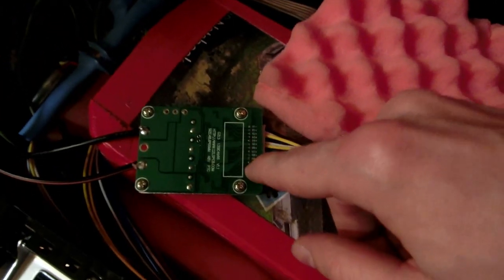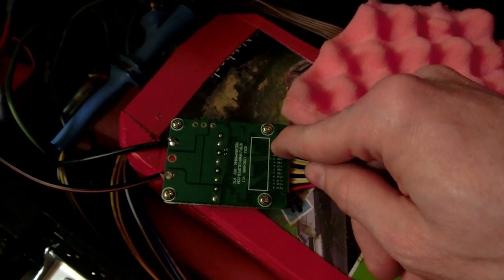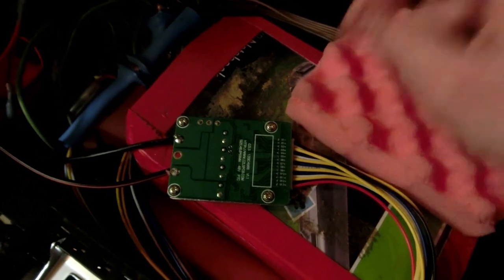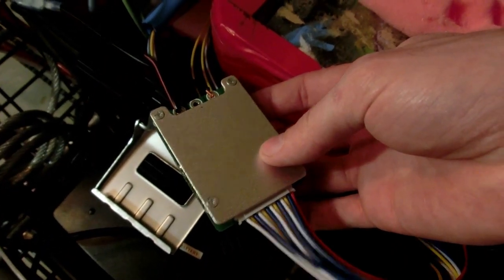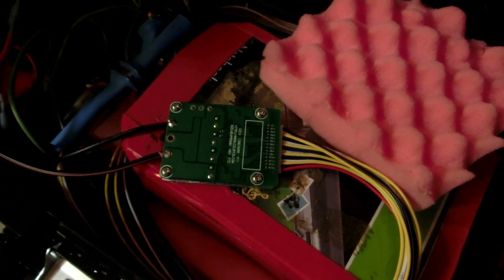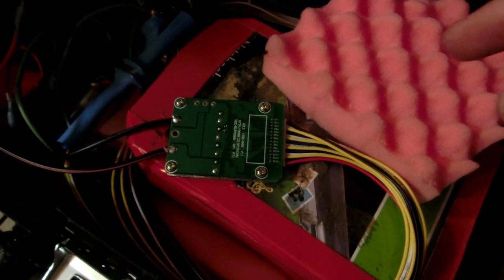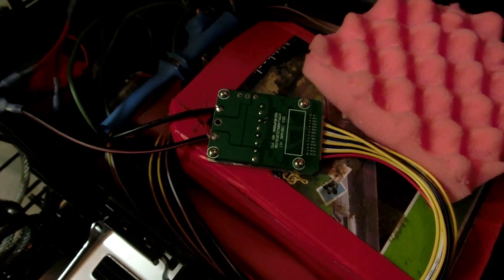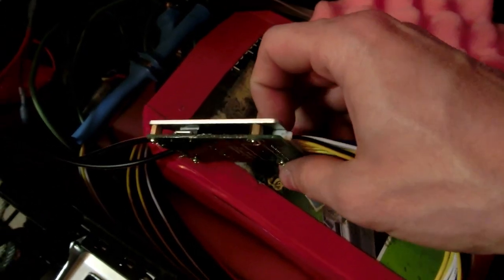The upgrade is actually a little bit noticeable — I have an extra 2 miles per hour on my top speed. It goes up to like 37 or 39 miles an hour now, under no load if I just pick up the front. Now, I've had a lot of issues with this BMS because it doesn't bring all the voltages up to 4.2 or even 4.1. The middle one goes to 4.09, and some of the later ones always go to 3.98. The people I bought it from are sending me another one. It's not balanced, but it's consistently going to the same state of not being balanced, so it will keep the batteries from getting too unbalanced to where they blow up.